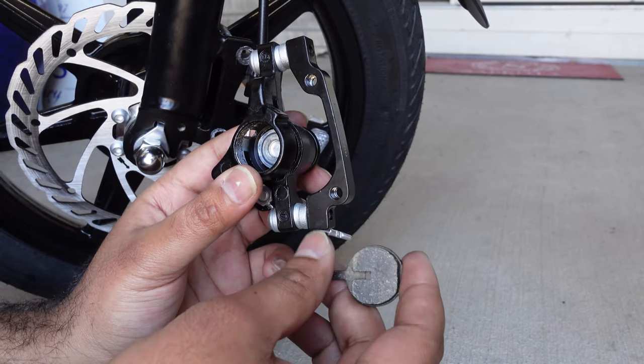Since the brake line is holding it in place, we are going to go ahead and put this here — and it went in. Now it's aligned with these screws and we're going to put the screws back on and then adjust it from the back again. Now this is the step where you're going to want to put your blue Loctite to make sure this is cemented in, but not red Loctite or anything stronger because then you're going to need a heat tool to remove it.